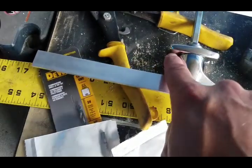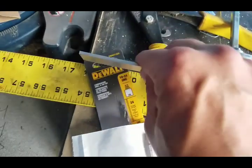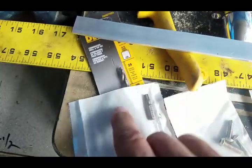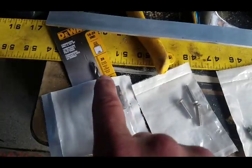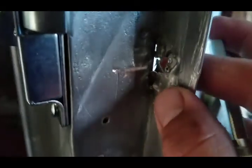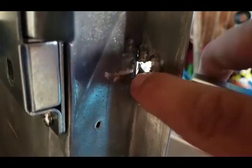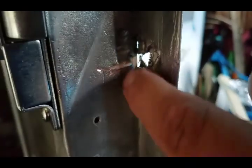On the left side, where we're going through the lip of the door, I decided to pick up some aluminum flat bar, and I got a 10-24 screw and a tap. So what I'm going to do is, let's see, I'll go over to the door here. Since this is so mangled, I didn't want to just try to put a washer and a nut and have it stick way out with a washer and like a nylock nut or whatever, because it's so mangled.